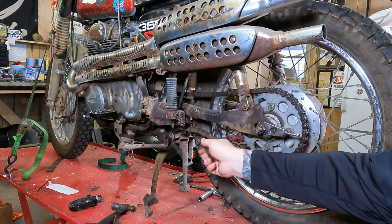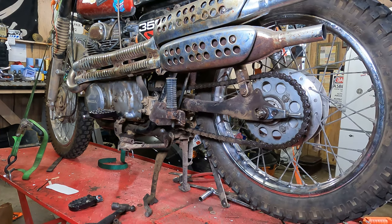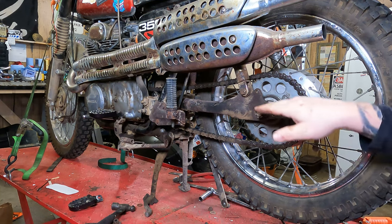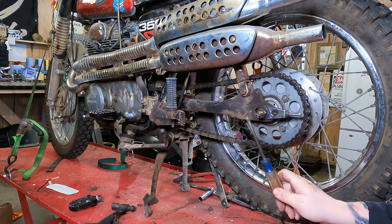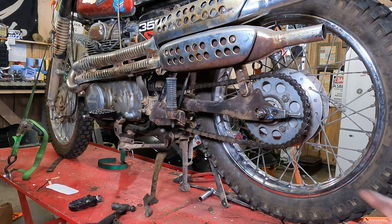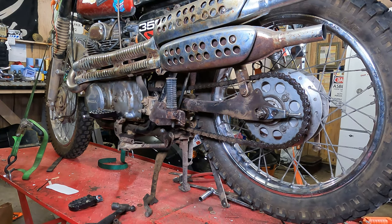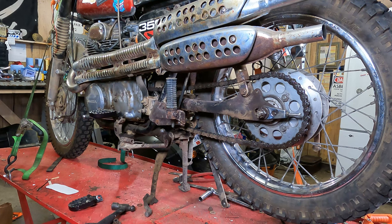However, I still have way too much slop right here. I do technically need to compress the suspension a little bit. I have a ratchet strap on the other side compressing the rear suspension so everything is pretty much in line — rear axle, swingarm pivot bolt, and the front counter shaft sprocket. The bike is essentially sitting at ride height. I usually just set it a wee little bit slack and then ride the snot out of it, but this is the internet and somebody's going to say you didn't set your suspension right — so feel free to argue with those guys in the comments.